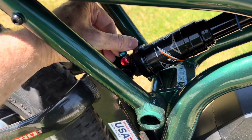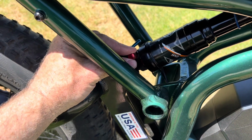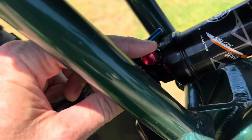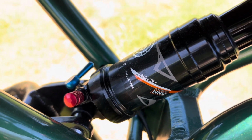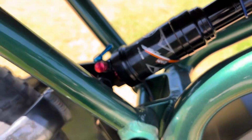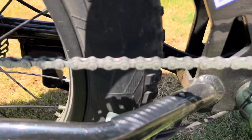It also has a lockout on it and rides real smooth. I set it for maybe 30 pounds heavier than my body weight because it's such a heavy bike, because the rating that they give in the book is for a bicycle. And then there's the model number if you want to get this exact shock. I'll put a link in the description as well.